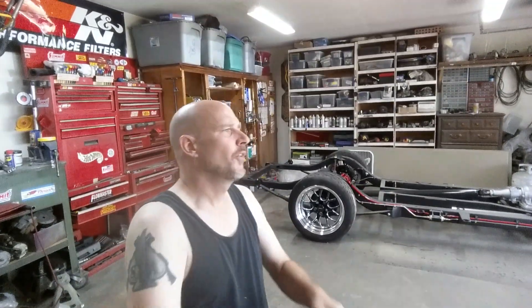I've been sanding on it for a couple of days now and I've got one whole side finished and I've started working my way around the cowl. There are areas of the car that it's not as bad. The door hinge area is the worst. I left the door hinges bolted to the cowl because during mock-up when I first started doing the metal work on the car, I had the door set up on it and everything. Then I took it all apart, blasted the door hinges, rebuilt them, did a bunch of work and put it all back together. Nothing ever lines up as good as it did in mock-up. So this time I decided to leave the hinges on the car and paint them on it, then just rehang the doors after they were painted.